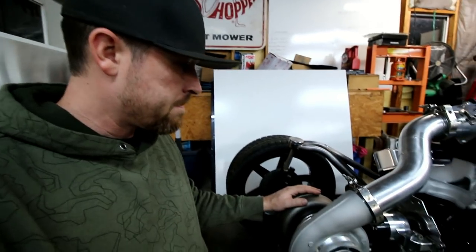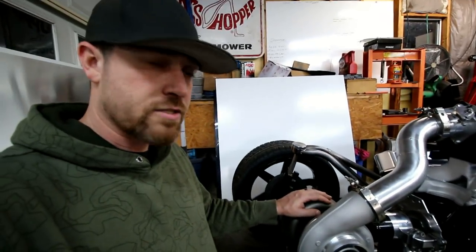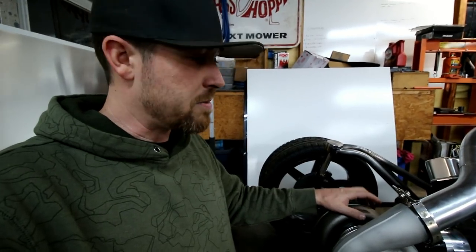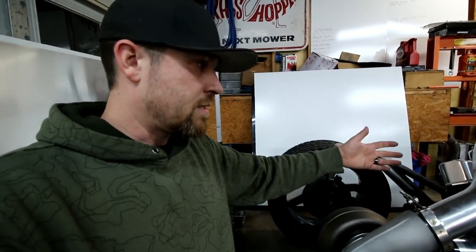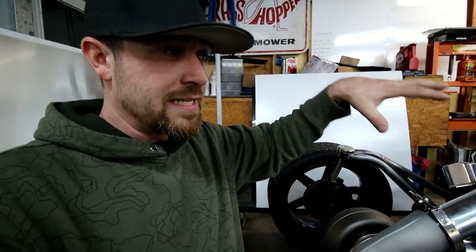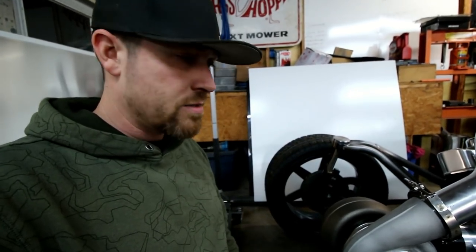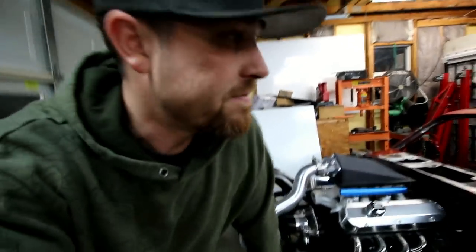Turbo mount — I kind of mounted this thing up as you saw at Pits, but I think I'm going to make some changes. Right now the turbo actually mounts to the chassis, but I think I'm going to get the turbo to mount to the engine instead — probably some kind of brackets on the cylinder heads, tubing comes off that and holds the turbo, with the hot side attached to the headers. A couple of reasons for this: it would be nice to take loose the transmission mount and motor mounts and be able to slide the complete turbo system, engine, and transmission out as one solid piece without taking anything else loose, then slide it back in.